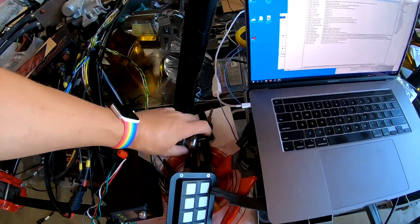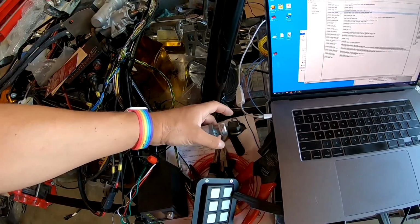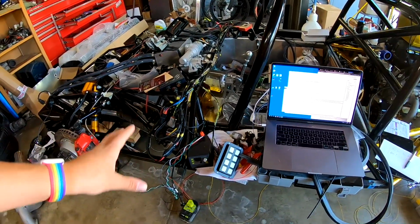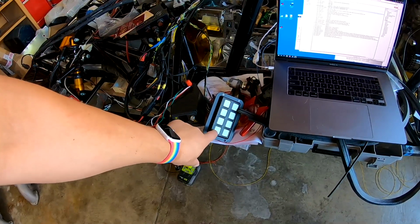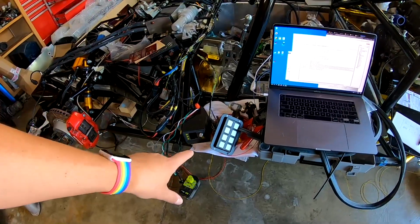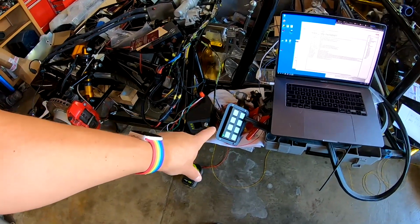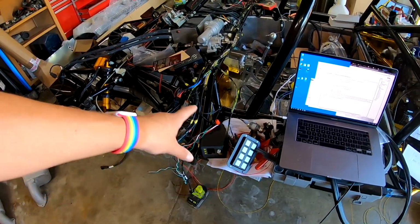So as soon as we turn our master switch on, this is basically the car in a ready or standby state. In standby mode, I have the power button blinking just to let you know that's the state it's in. Everything is off, but our CAN pad has power, which is important because that tells the rest of the system what to do via button press.